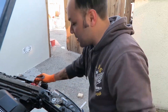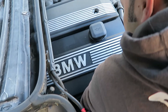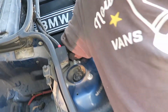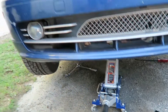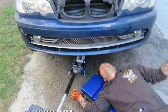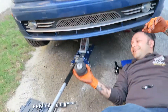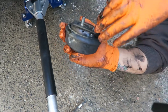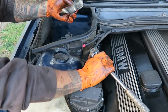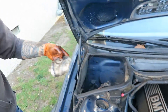Got the heat shield out, jacked this side of the engine up. I already got the other side mount in to give me leverage. This one's not blown out — it's still dirty though. The bottom maybe — who knows. So I got this in, tightened it up, left out the heat shield. I'm just gonna run without it because there's lots of space between the exhaust manifold and the motor mount, so I'm not sweating it.